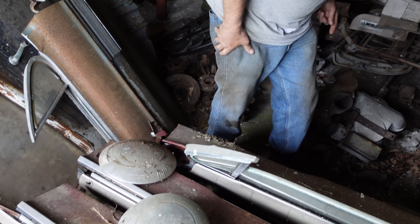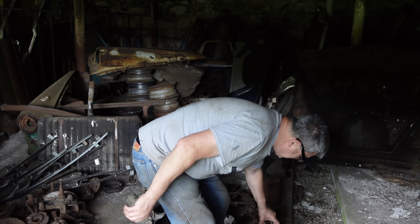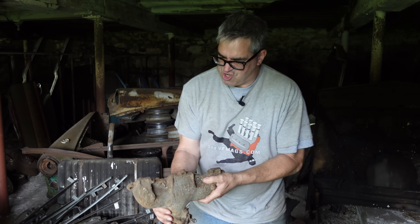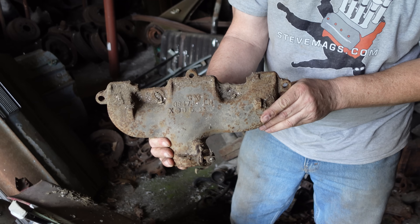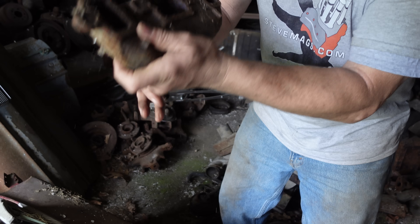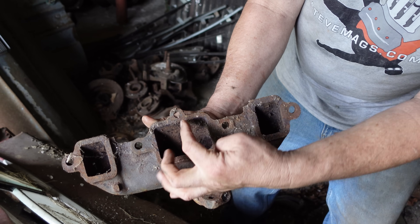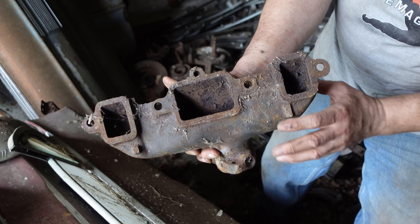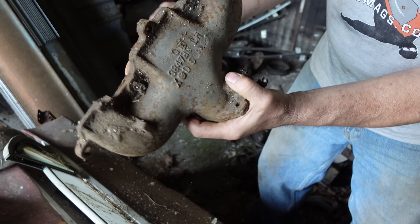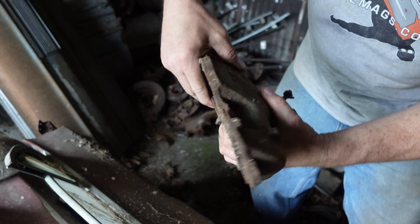As we go deeper in here, just wherever you look, weird stuff. This is an exhaust manifold — looks short, like from a V6 or something. Well, no. The Olds 330 through 455 had a very compact exhaust port layout. The outsides and the centers were close together, so this is actually from the Olds 330 through 455, including the 403 — a very short little manifold compared to a typical full-length one. This is not a V6 manifold.